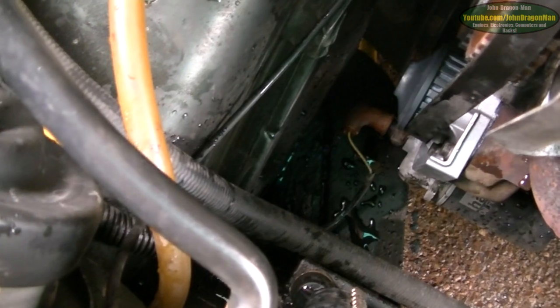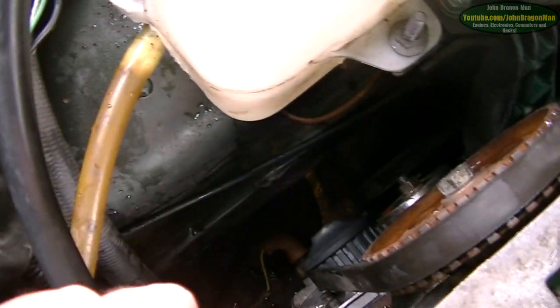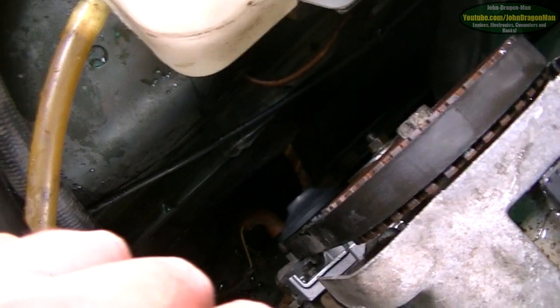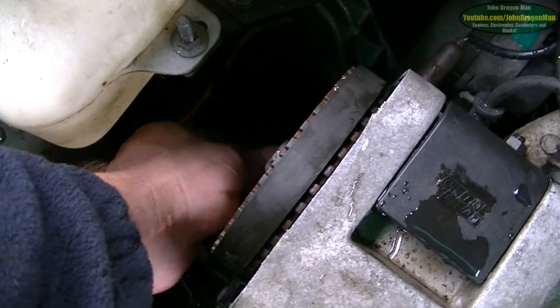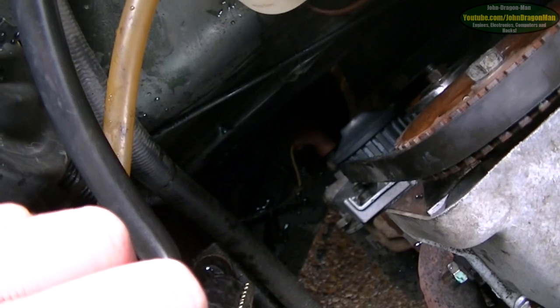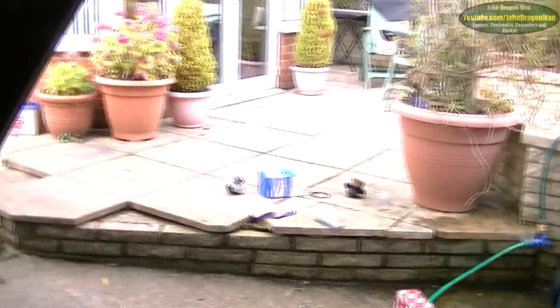Tips with your timing belt: don't play around with your timing. When you take the belt off, don't start turning things all around, because otherwise you'll mess your timing up and you'll have to re-time your engine again — that can be a pain to do. Luckily I remembered not to do that, and hopefully the timing's alright. I've turned the engine over by hand at the bottom and it seems good — it's still got its compression. For tensioning the pulley, don't forget you've got to tighten that up, but you don't want too much tension on your belt — you've got to have a bit of play in there. Too much strain can wreck the seals, and normally it's the water pump that suffers. It could have been what happened to my old pump.